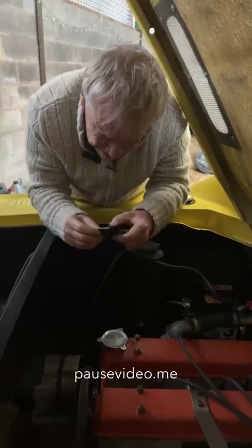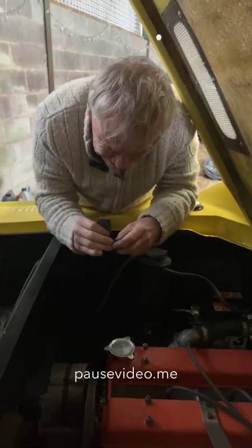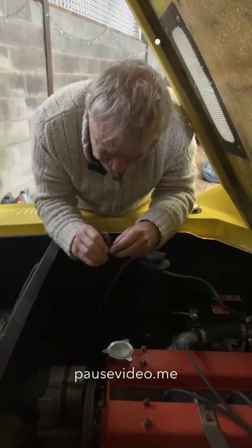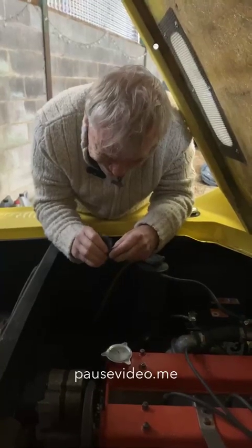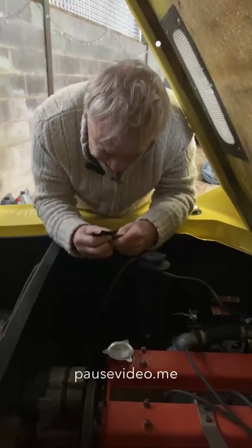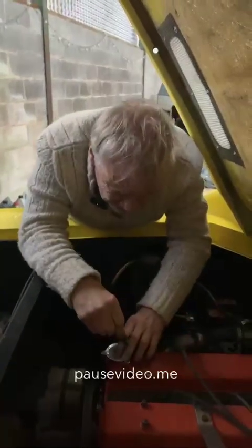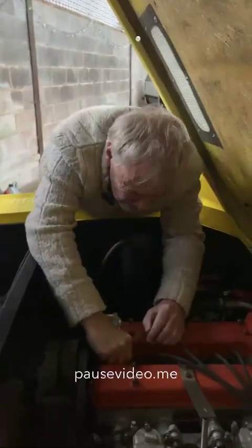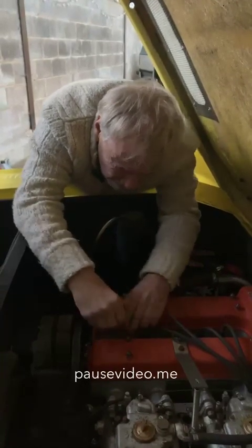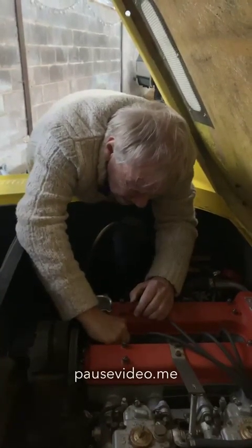I had to go back in the house because Simba the cat insisted on helping me. These are NGK Sixes, and I think the number denotes how hot the plug is. The lower the number, the hotter the plug, and the hotter the plug, the easier it is to start because it doesn't get fouled up as much.